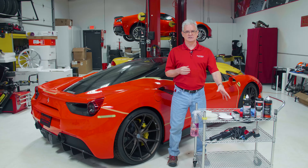The better your finish is on compounding, the better the finish is going to be on the finish polishing stage. So that's what we're using on the compounding stage, but we're still testing, monitoring, evaluating, taking measurements, and seeing what's giving us the best results on this particular car on this particular day. Then when it comes to finish polishing, we like using the Sonax Perfect Finish, usually with a white Rupes finishing pad, sometimes a yellow, depending on the paint. This enables us to do a two-step process — it bridges that gap and has a lot of cutting ability and super fine finishing ability as well.